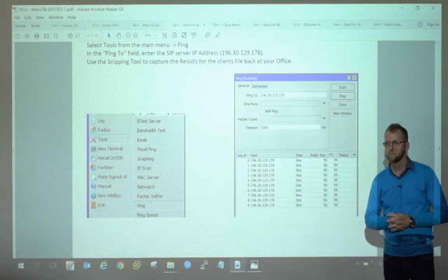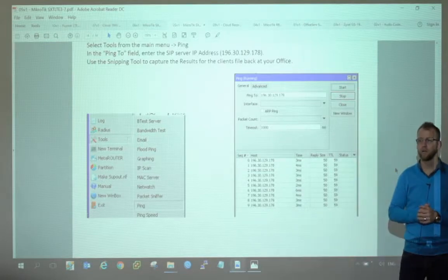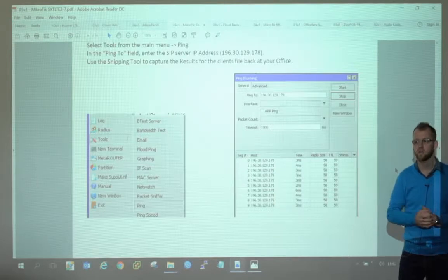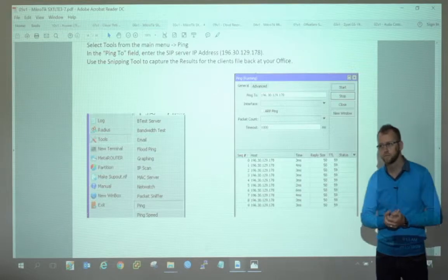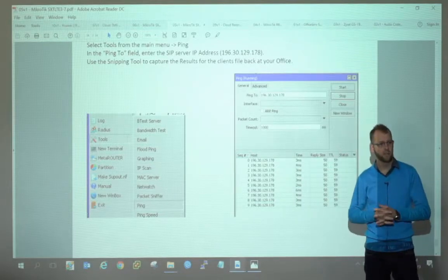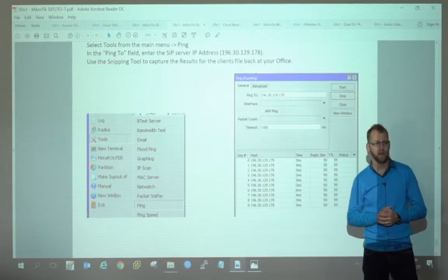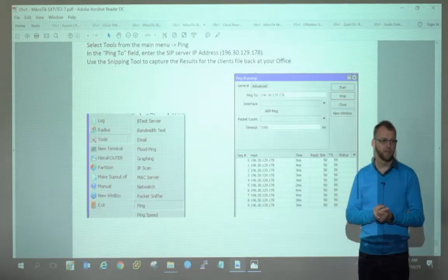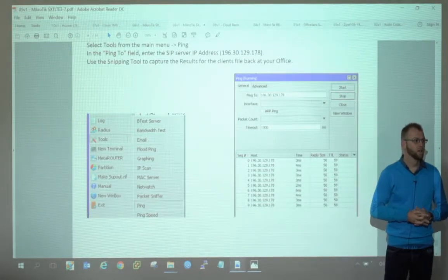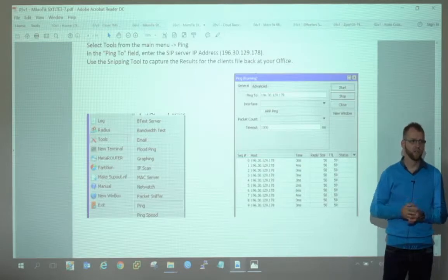Okay. And wind, that's affected. Remember, anything can affect signal. So if it's indoor and there's window tint, some companies have very thick window tint, depending on where they are. That can affect signal. It's possible, yes. If you install a unit, do not install these indoor units inside a cabinet. Also, not just on top of the cabinet, try and install it as close to the window as possible. Okay. If you get a Billion router and you have the external aerials, do not put the Billion router inside the cabinet or on a shelf or so inside the server room.